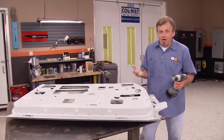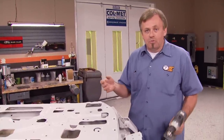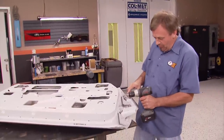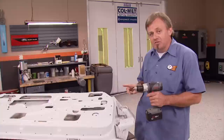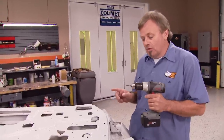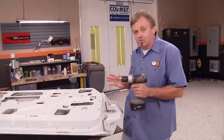I'm going to take the hinge off of this thing, but before I do, I want to share a little secret. Any panels on the vehicle which are removable and adjustable — such as doors, fenders, hoods, which are a pain in the butt to align — before I take them off, I'll drill a couple of holes that I can use as alignment pins later to put back in basically the same spot and tighten the bolts up. It will save you a lot of time because you're probably going to be about 95% back to where you started.